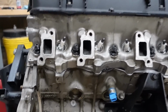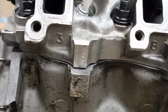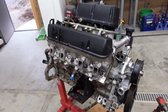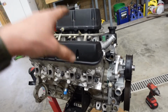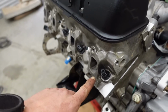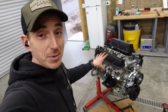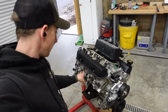Another neat thing I noticed was these cylinder heads right there are actually stamped Callaway. This one is marked 1176 and the other side is 1200. But another thing to make note of, if you are ever looking at a Discovery or Range Rover or something with this 3.5, 3.9, 4.2, 4.0, 4.6 Rover V8, if you happen to look in the engine bay and you see a set of studs like these instead of a bolt head like that, you definitely know that the head gaskets have been replaced and they upgraded to studs. It's nice that you can see that externally.